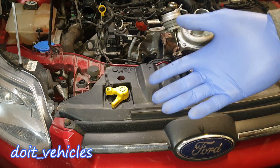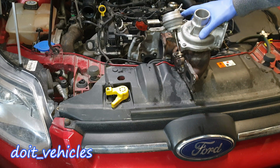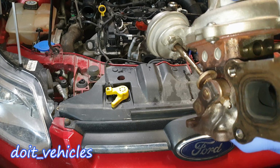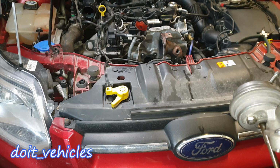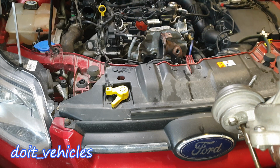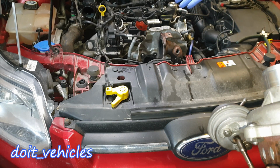At this moment you've got the electric supercharger, you've got the supercharger with a belt, which basically takes some power from the engine in order to push more air into the cylinders, or this turbocharger, which will take the energy which is produced by the exhaust. Since the exhaust comes with high pressure, the engine is basically a vacuum cleaner. You have on one side a lot of vacuum, which is the intake of the engine, and on the other side the same force produced by the vacuum is going to be released outside with pressure, which is going to be the exhaust.